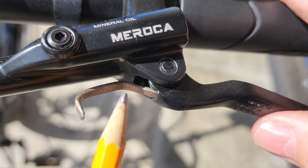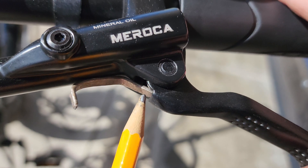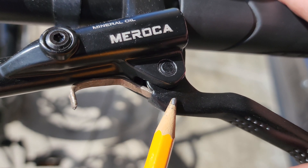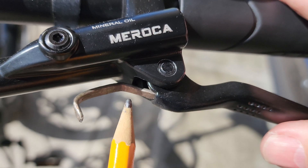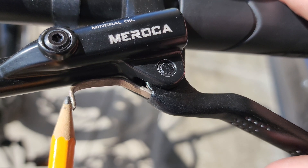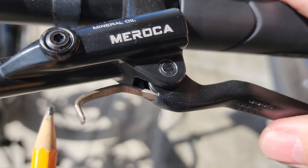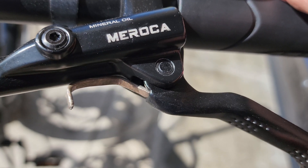This little flat rod, I hammered it out from a piece of scrap stock that I had in my toolbox. Made the bends — it goes into the lever here around this pivot, which kind of holds it in place. It's got the bend to follow the contour of the master cylinder, and right here it has a flip-out, and that flip-out is where the magnet's gonna go, and that gives you enough travel to trip the switch.